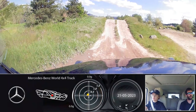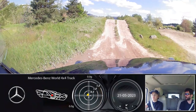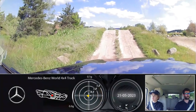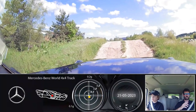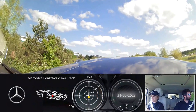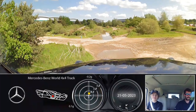We're going to crawl up here. I really want you to focus on smooth, patient throttle - when we get to some of the steeper hills that's going to help out quite a bit. A lot of people as they go up here can't see the ground anymore so they start steering - you don't need to. Once we've got ourselves lined up just keep the wheel straight the entire time. Whenever you're ready, nice and slow - straighten that wheel, that line's perfect. Keep the wheel straight from there. Nice work.